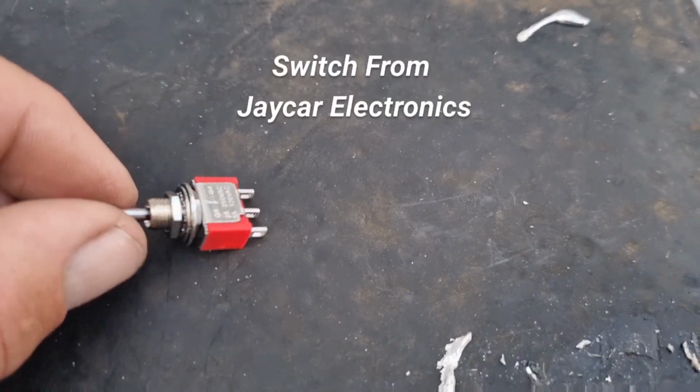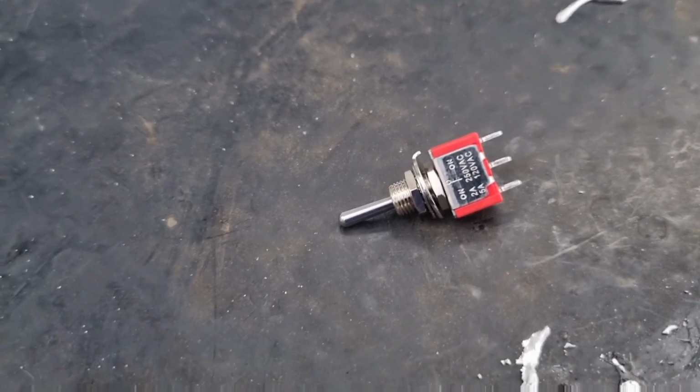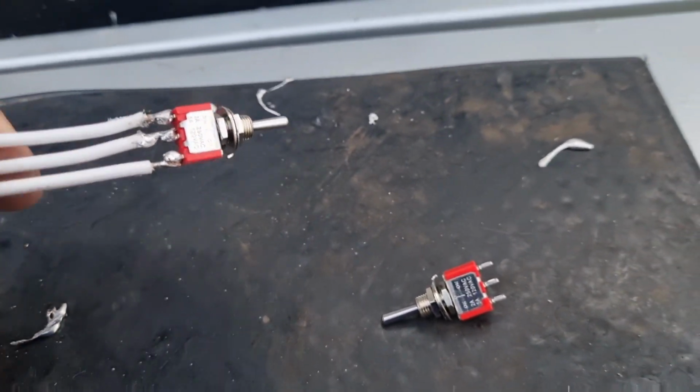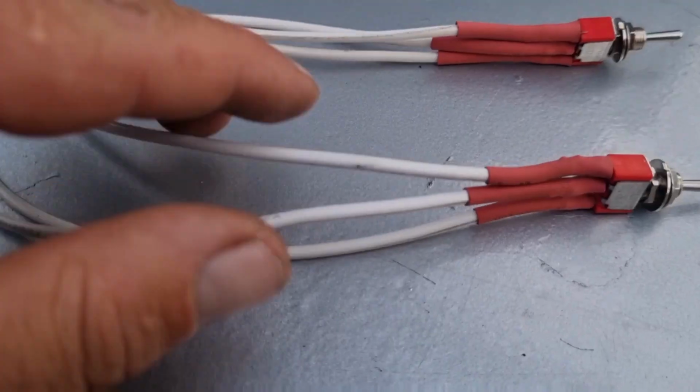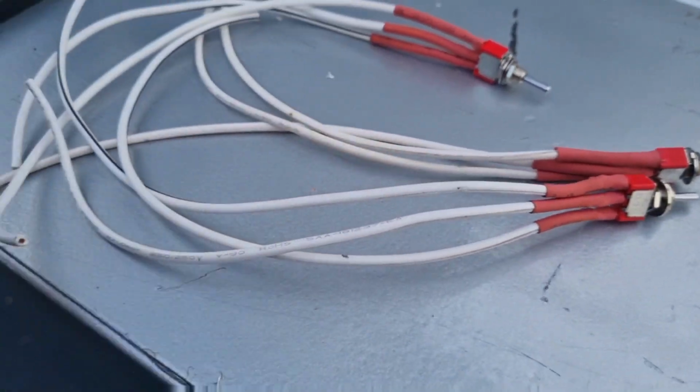Okay, I only need a couple of things really to do this, and one of them especially is the switch. It's a 3-position switch, so you can flip it up, flip it down, or put it in the center. Center is off, and the other two are the different color lights. So pretty much you just got to solder 3 wires onto these little terminals, and then what I've been doing is heat shrinking them as well. Heat shrinking is pretty easy. You just chop the heat shrink off and heat it up with a lighter or whatever heat source you've got. It just protects the wires from shorting out on each other. Pretty easy to do, guys, don't be scared of that. And then once you've done all that, you're ready to go. You start putting it into the light.